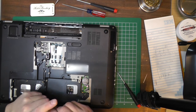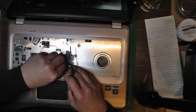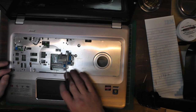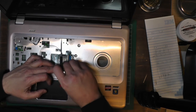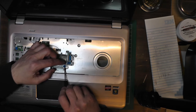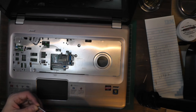That battery is going to last longer than I'll have this computer — we hope. Now for these connectors: you've got to lift these carefully and then feed them in here. One comes from the power switch, there might be a card reader under here, there's a fingerprint reader one, and this one comes from the touchpad. They are unpleasant at best to get in without breaking the little clip. I'm going to take my time — actually that one went in pretty good. Two screws here marked 'palm rest under keyboard,' and these are marked with a little arrow.